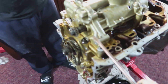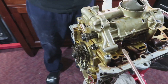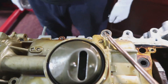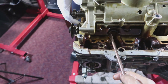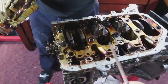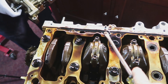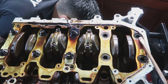For the oil pump and the oil pickup, all you need to do is take off this bolt, this bolt, this bolt, and this bolt — everything should lift up. If you want, just pry it a little bit and pull that. You also want to take off these two 10mm bolts right here, and then take these ones off — they're all 14s. Go ahead and take them off in a directional way.